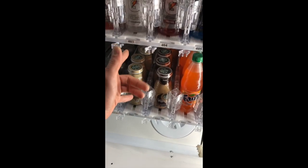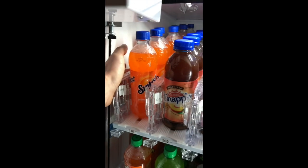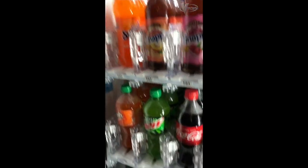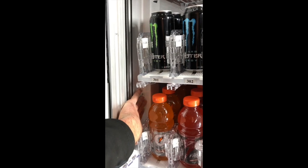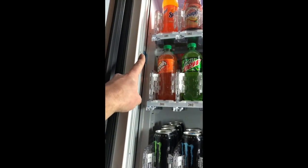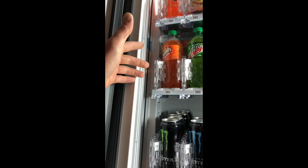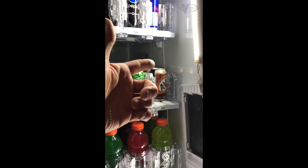The tray is lower. And I started measuring — I took several measurements — and all these trays are the same distance apart all the way up, but it's about 3/16ths of an inch from the top of this bracket up here, right there to the top of the ceiling. Difference — it's higher on this one as opposed to the other one. And so at some point they made a mistake when they were manufacturing this machine with their template or something, and the bracket itself, the holes that they had to drill through the wall are in the wrong spot, I think. Because I measured the distance between that top screw up there and the top of that bracket, and it's only off by about a 16th of an inch. So I think the holes are actually drilled in the wrong spots on this wall, and somehow they must have had to do it on both sides a little bit for it to still be decently level, which it is.